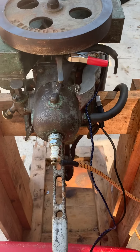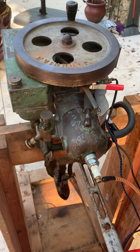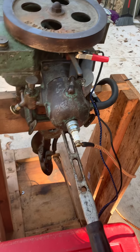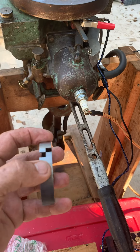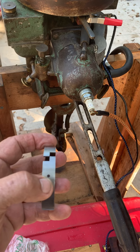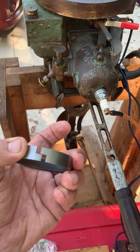We're going to see if we can run it. I just had a piston ring built for this thing, and a piston ring for it is huge — it only uses a single ring. The ring is a half inch wide. It has a hole in it for the locating dowel on the piston to keep the piston ring from moving and catching a port, and it has a stepped gap in it.